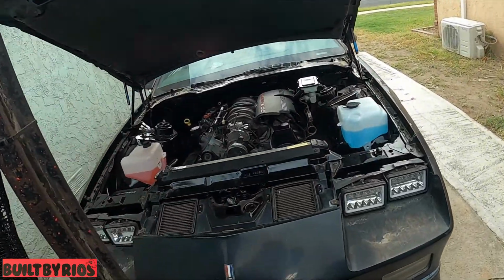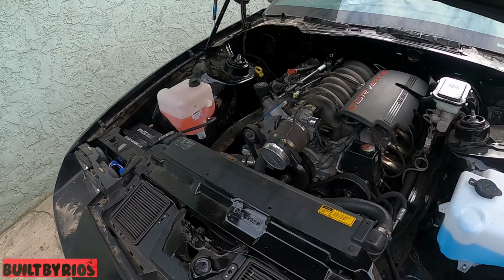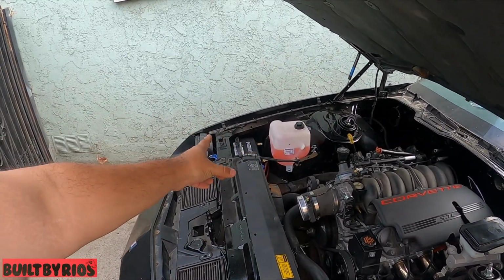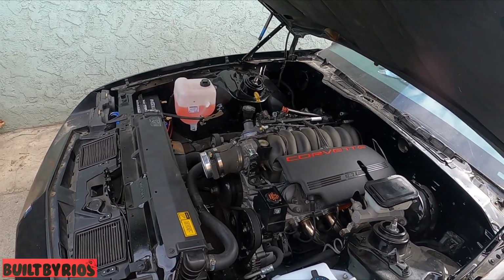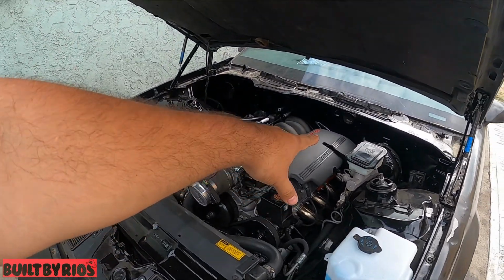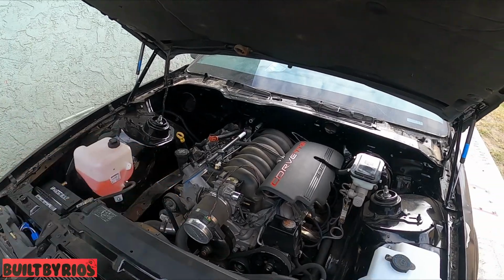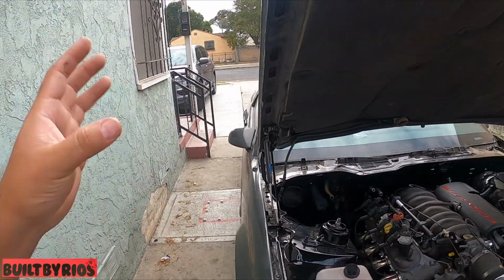And let's bring you out here. And it's Ishkar. Ishkar finally has a harness. The alternator, I had to change it because it wasn't charging the battery and it killed the battery. Brand new battery, killed it. I figured out it wasn't charging, but it was too late. It killed the battery. I still gotta mod the cover so they can fit in flush. I had that one, needs a lot of cutting, so that's why it's not on. AC unit is not going in, but it's in the trunk until he's ready.